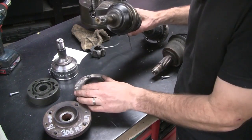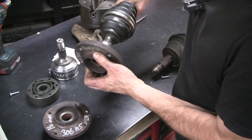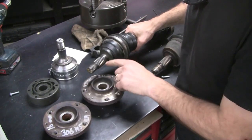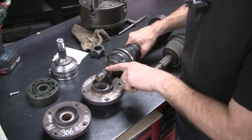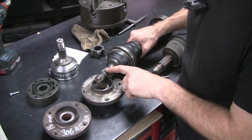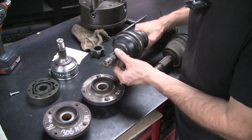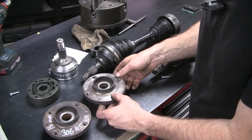They're off a Lancia Beta. But unfortunately, they don't actually fit. They're either a different pressure angle or a different tolerance on the OD of the drive shaft. I could try putting this in the lathe and skimming a little bit off the teeth to see if it does slide in, but I think we'll go a different way.